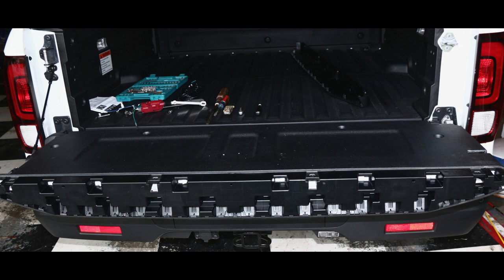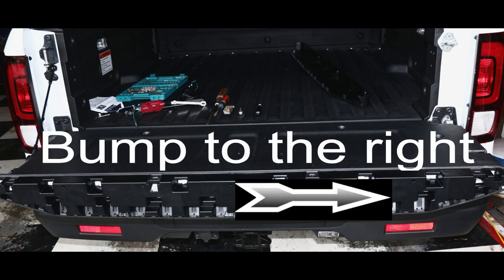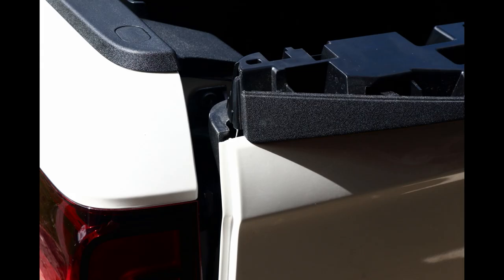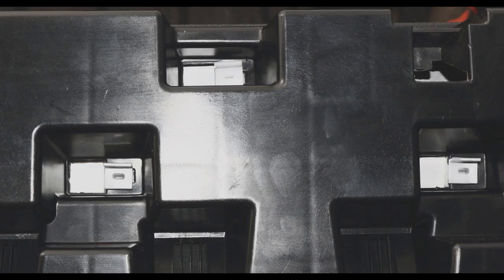Removing and replacing the plastic skin of the tailgate is honestly the most challenging part of the installation. I found the top edge of the cover can be bumped to the passenger's side to slide it off its hold-down clips. This is easier than removing the clips as per eTrailer instructions. Do note the orientation of the clips — a quarter turn in either direction will make them impossible to fit their mating slots during reassembly.